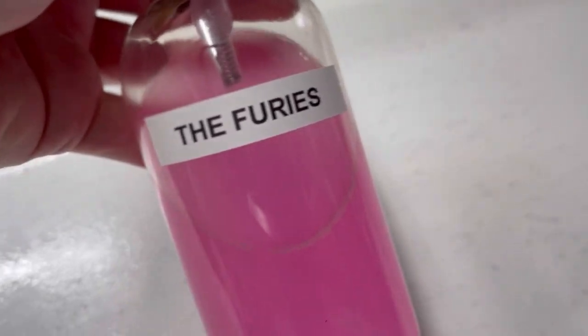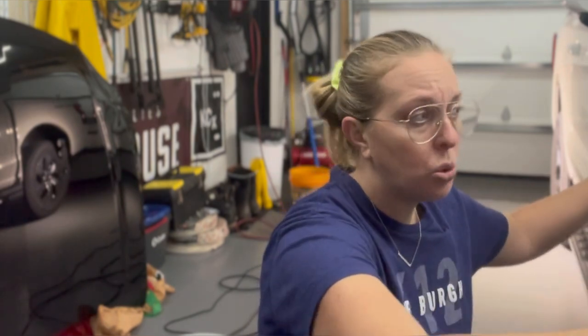During chemical decon, you're spraying a product onto your panel that's going to react with any ferrous metal on the panel — you'll notice that purple bleeding phase, which is the chemical reaction that helps loosen any bond with rail dust. Then you come in with a clay bar or clay towel treatment over that surface. Typically you do this outdoors with free-flowing water, rinse it all off, dry, and keep moving. But what can happen is that chemical decon is often a very thick, sometimes viscous product and it can leave a lot of residue behind — and that's the number one enemy to any coating. You don't want any residue on your panel, be it soap, polish, oils, or chemical decon.